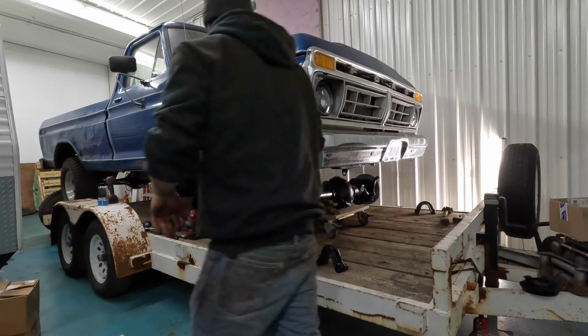Well, back again another day. Just have to get the tie rods on this new front axle. Pretty much just did a tape measure alignment compared to the old one. That'll be good enough for now. Got to get one of those alignment kits or make one out of some angle iron or whatever holds a tape measure front and back. We'll work something out on that.